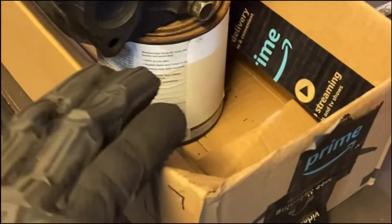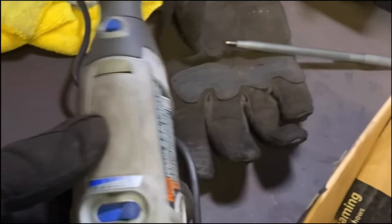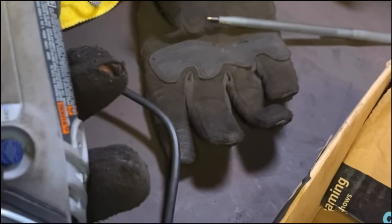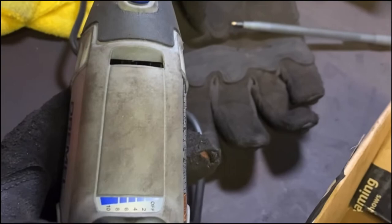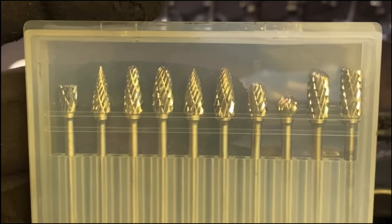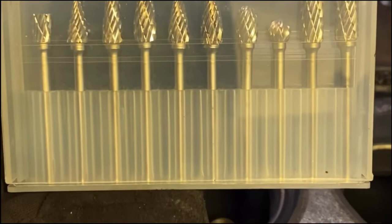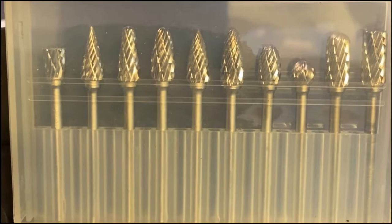I always say I've got my PPE: my gloves, some ear protection, some eye protection. What I'm going to be using is this little Home Depot Dremel tool here. It's got a variable speed on it, which is huge when it comes to porting. These aren't as good as pneumatics because you can actually throttle your pneumatics and get a feel for it, but nonetheless this is easily used for this. For the bits, I'm using some small carbide tips — I like this little pack here. It's about a $20 pack you can get on Amazon or eBay, and it's got a lot of different shapes needed to get the small crevices. The only downside is the shaft is not that long. I'm not going to try to hog these things out — just massage it to get it to flow a little bit better.